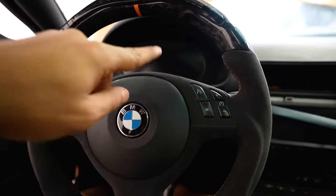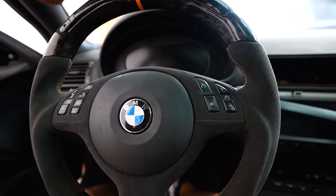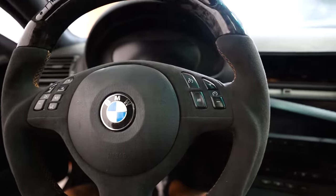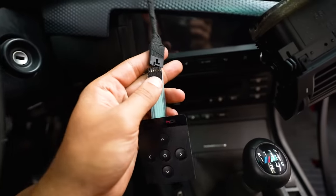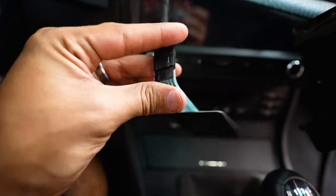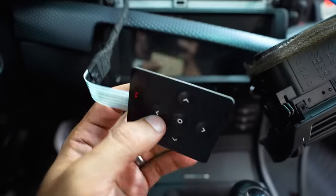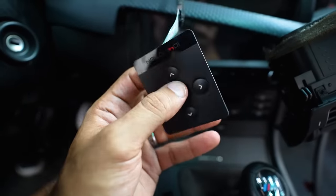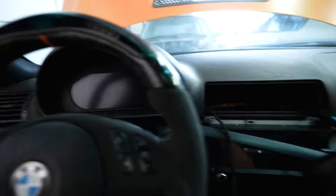What's really cool is that unlike the E90X clusters, you don't have to do any modification to the inside of the dash. With the E90X you have to cut a template out of the air tube — with the E46, nope. You just put everything where it goes, plug it in, and you're good to go. The last thing to do is plug in the remote, which snaps right into place. You can position it wherever you want — it has a sticky 3M backing. You can place it in either orientation and even invert it in the cluster menus if needed.